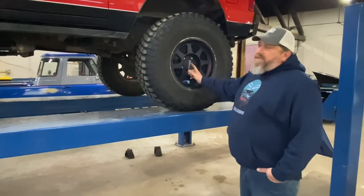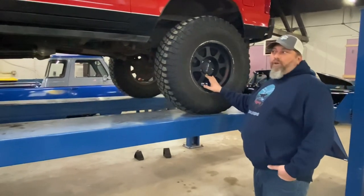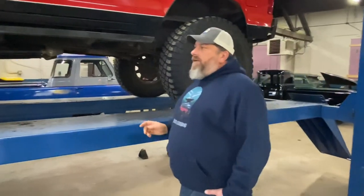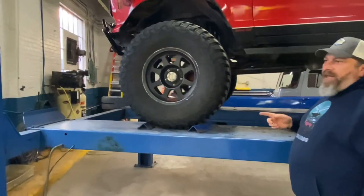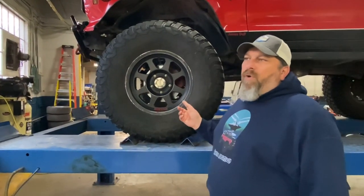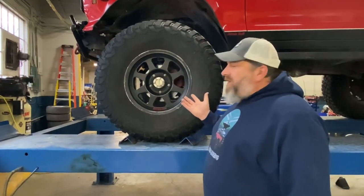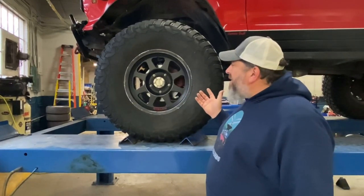As far as the brakes, in the back is just stock 11-inch drums, like an early Bronco. In the front, we do have the upgraded James Duff kit that I bought. That's basically, I think, the Lincoln Ford Thunderbird 80mm single piston calipers on 11-inch rotors, and it's pretty basic.